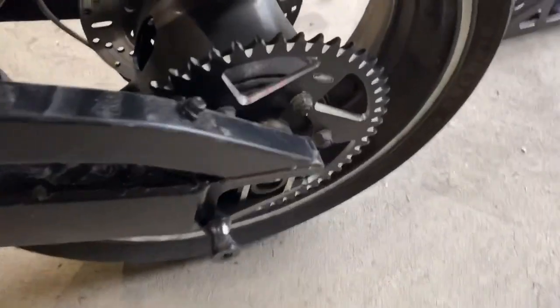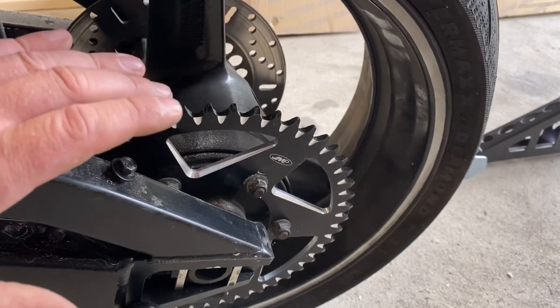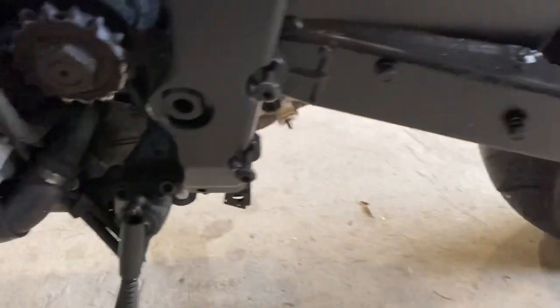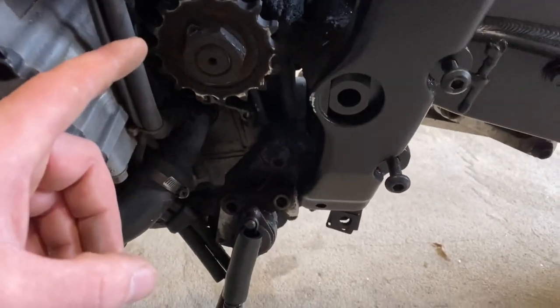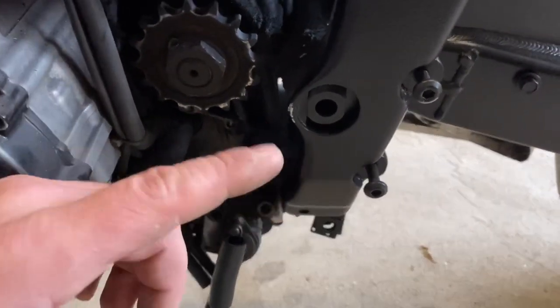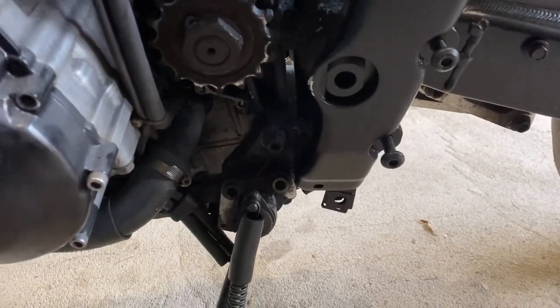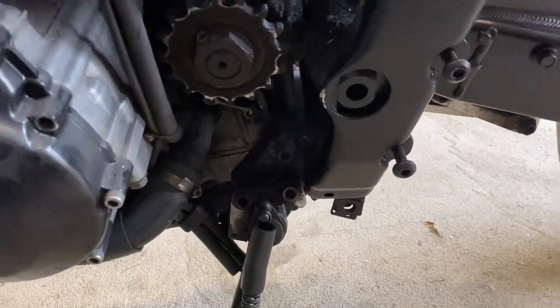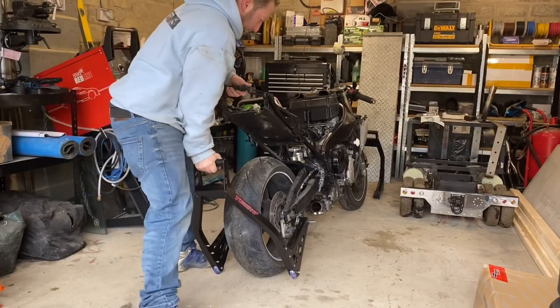As you can see we've got a new rear sprocket — that's a larger sprocket, a larger amount of teeth. We're going to be swapping out this smaller cog for a larger one at the back and a smaller one at the front. That'll give us faster acceleration, we'll be quick off the line, and it's going to be wheelie happy.